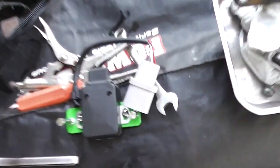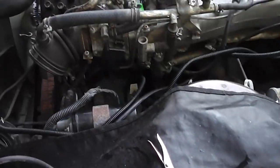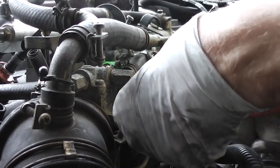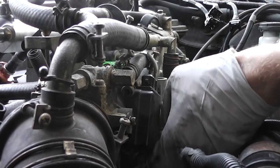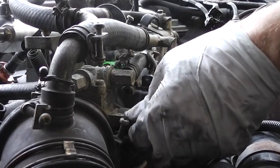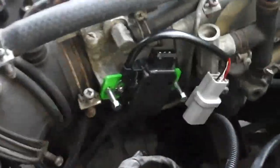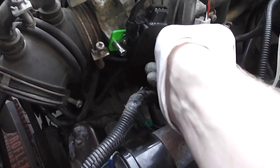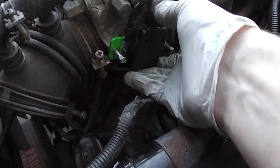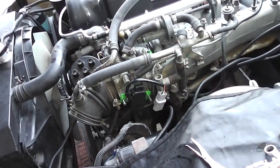The last thing I'm doing tonight is installing the throttle position sensor supplied in the kit. This is a 240SX S13 sensor, and with a little adapter plate it fits right in place — very simple, just two screws, same as the stock one. The stock sensor pops right out. The new one goes on with the bracket, extended screws make it easy to hand tighten. There's also a center adjustment we'll set once we fire the car up, to make sure 100% is 100% and 0% is 0% in the ECU.